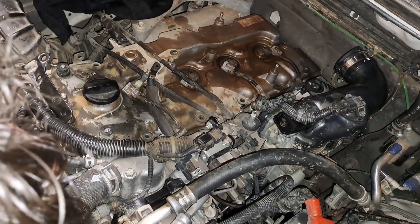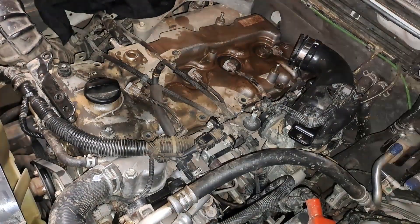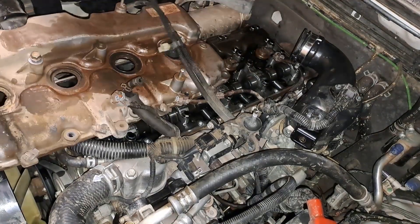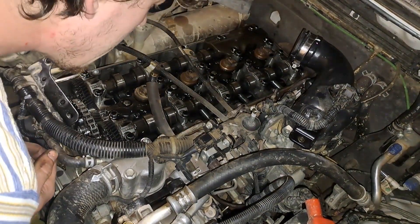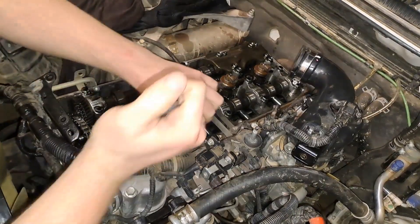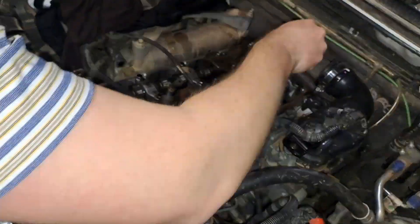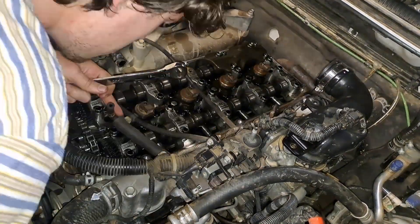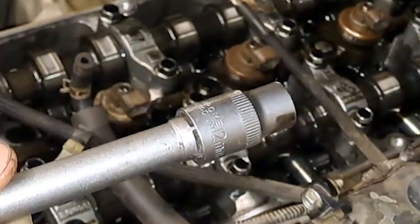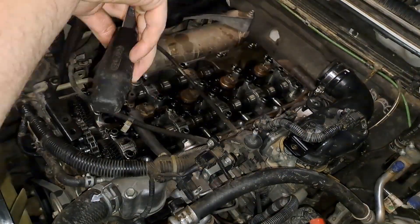At this point nothing's preventing you from taking off your tappet or rocker cover, so you can just shove in a screwdriver at some wedge points if you can find any, then pull up piece by piece slowly, making sure you're not damaging anything. On the side of your motor you've got your fuel lines coming up with two clamps holding on two pipes each — loosen those up and take them out with a 10mm socket. With these JJ1 engines, the fuel lines go through the head of the motor, and there are nuts on the side that you have to loosen with a 19mm open-ended spanner to pull the fuel lines out. It's a bit fiddly but it does the job.